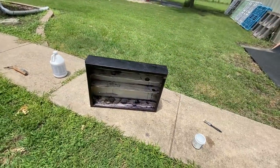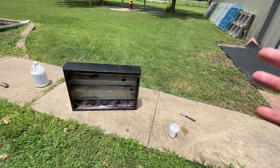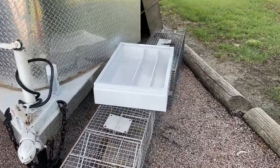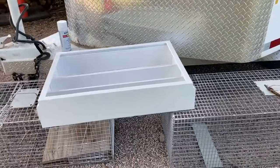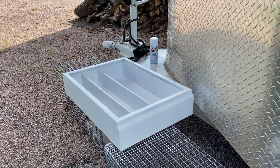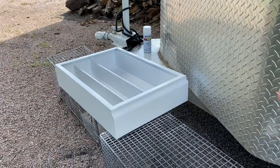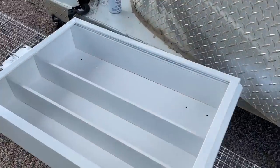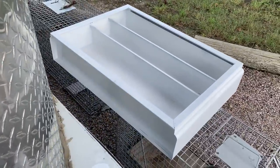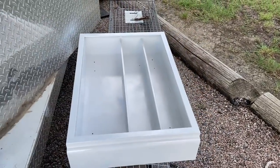On this side I didn't put any of the spray-on rust converter — I just used the brush-on. You can tell the black dots and how it turns black when it seals. I let that dry — I think it's supposed to dry for like 24 or 36 hours. I'm going to get a can of white spray paint and paint over that, and hopefully all the rust will stop. So I put one can of white spray paint, high gloss, on the outside. I did one coat, let it dry, and ran out of can. Had to go get another can — looks like it took about a can and a half to finish and touch up, since some of the black was coming through.